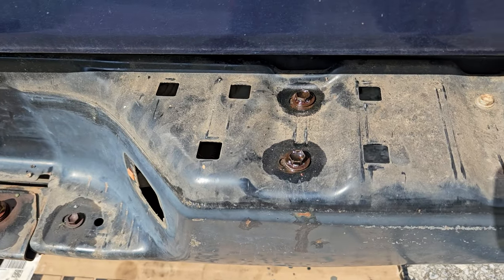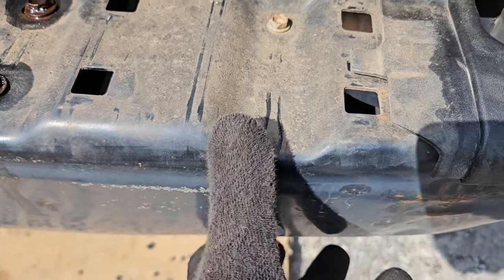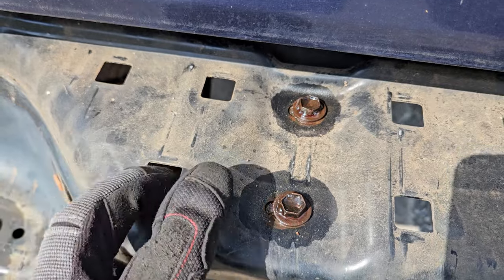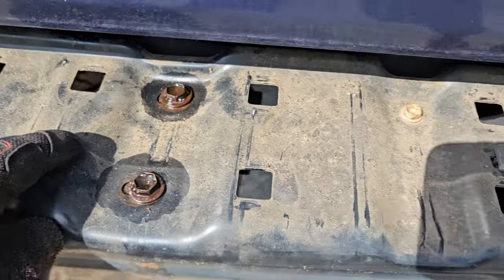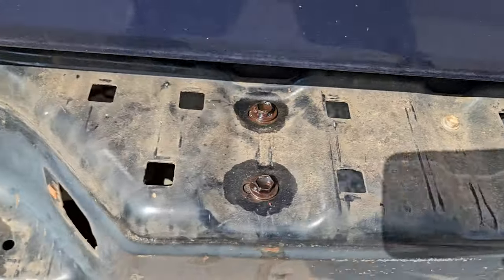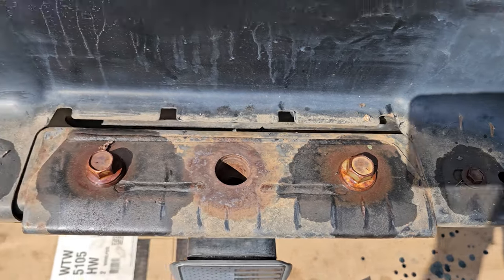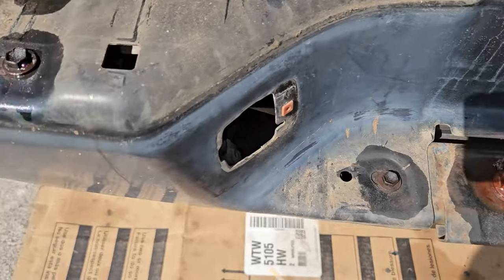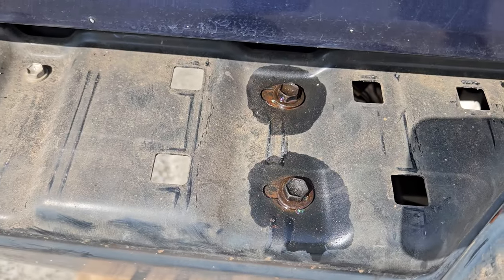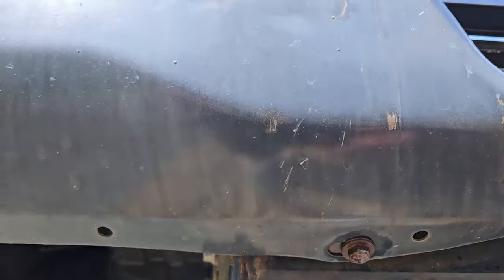The next step is to remove the bolts. You've got some 10-millimeter bolts on top and some 10-millimeter bolts underneath — that's two on the metal bracket that comes off along with the rest of the metal bumper. You don't have to remove that. All the 12-millimeter bolts do need to be removed. You can see where I've put some penetrant on them. These plastic side pieces also come off with the bumper — you can remove those once the bumper is off. You also have two 12-millimeters on either side, underneath.